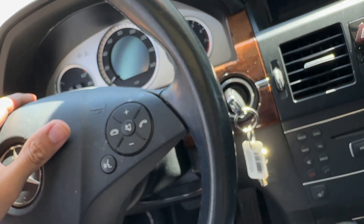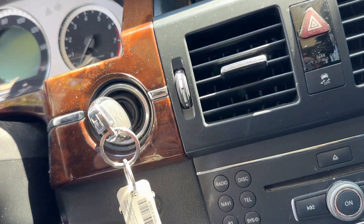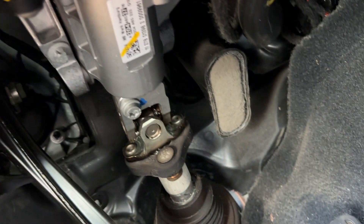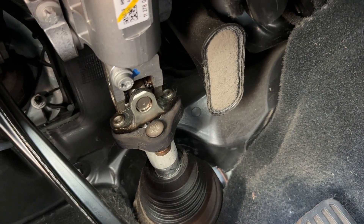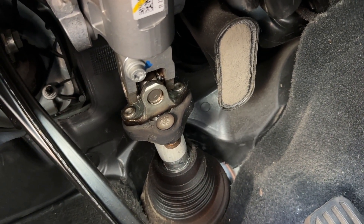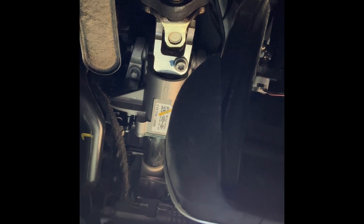I'm gonna leave the key in there. Right now it's in the unlock position — makes the job easier. You don't have to remove the whole column to get the steering lock out. First thing I'm going to do is go to the lock itself. This client already has the kick panel off; he had a mechanic working on this thing. The mechanic decided not to do the job, so Jim found me on YouTube and called me up. He's local to Whittier, California, brought it down this morning and we're gonna get it done. I'm gonna stick my hand up through here, reach up to the steering lock, and disconnect the electrical connector — it's gonna come out on the left side of the column. I found the connector and the lock is disconnected. Just that simple. Only the kick panel is off.